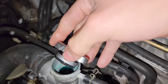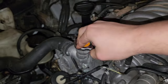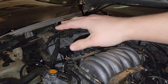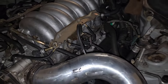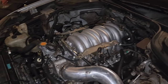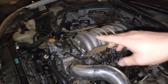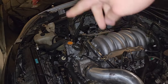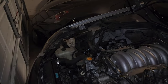I've been driving it for a few days and it hasn't overheated. I'm using a funnel I purchased from Amazon - it sits on here and raises the coolant level to the highest point of the car so it can bleed the system properly. You need to open the screw right there to allow all the air to come out. You'll see a bunch of air come out and the coolant will push it to the top. Keep adding coolant until it fills up and stops going down. Don't overfill the cooling reservoir - put any excess in that reservoir so you don't throw that coolant away.